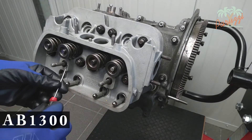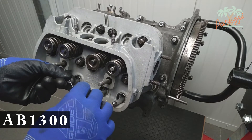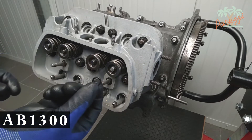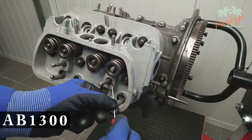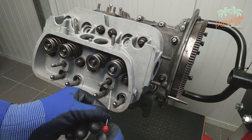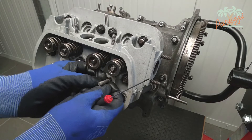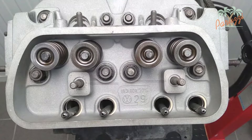Over the studs of the rocker shafts there are O-rings. Remove both O-rings and check that they are not hardened or torn. Caution: not all VW Type 1 engines have these O-rings. 25 and 30 horsepower engines have no O-rings at all. 34 horsepower engines up to 1965 use rubber gaskets instead of O-rings. If on younger engines you do not have these grooves for the O-rings, then the studs are mounted in a blind hole, and sealing with an O-ring is unnecessary.